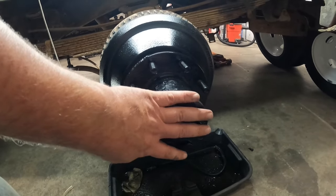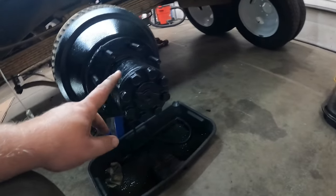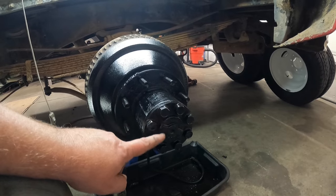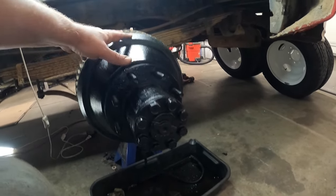You can see she just twisted right off, so now I have no choice - I've got to go ahead and break down the rear brakes and get the wheel cylinder out. On these full-floater dually rear ends there's no really easy way. You've got eight bolts holding the axle flange in, so you've got to get those broke loose and slide the whole axle out. If I remember right there's an oddball nut in there, some lock washers - I just don't feel up to it tonight.